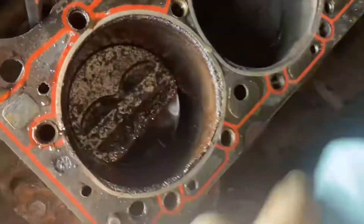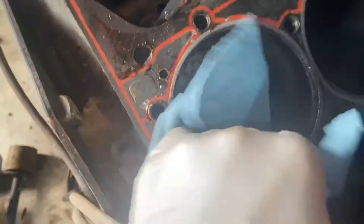There's definitely some mice living in these cylinders, but you can still see the factory honing. Long story short, I think we're going to be okay. This is the worst of it — the cylinder that had the locked-up valve — but I think we can probably hone this.